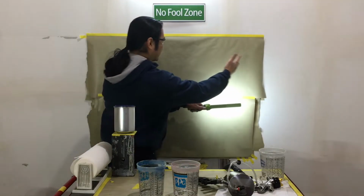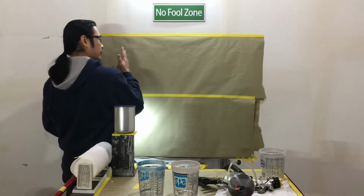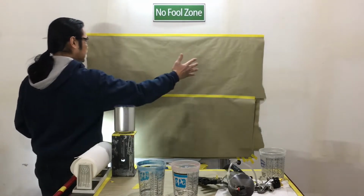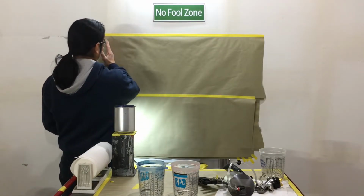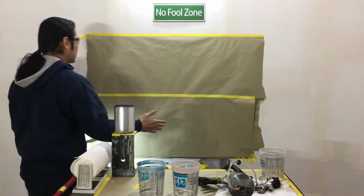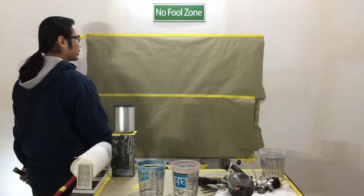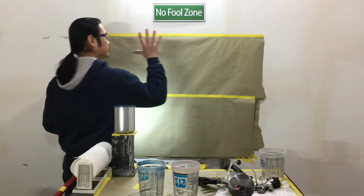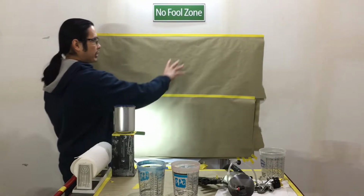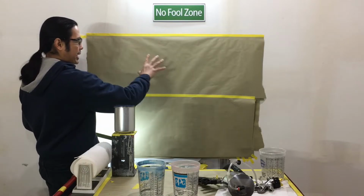I'm looking, I'm watching. That's why my technique tends to, and you need to work on this too, because some painters are slow this way, but then they're fast this way. And then it's their timing. If you watch a painter, the times. If you're a consistent painter, your time is consistent here to here to here to here. And if you need to work on that time, you count in your head like a musician, you're on tempo. Otherwise, if you're not on tempo, you're speeding it up and slowing it down, you're going to have more paint in one area, less paint in another area, and you're going to have an issue with this area having more paint that's going to start to run. And this area being a little bit more dry or medium wet coat, and you gotta buff that area out. So that's something you look at when you're spraying.